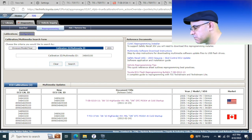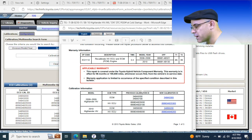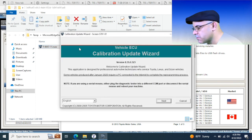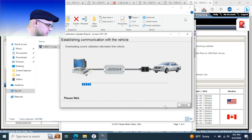This page, under configurations — which is under the calibrations tab, which is under the reprogramming tab — is where you'll put in the VIN and look it up. This TSB referred specifically to a calibration file for a 'runs rough when cold' condition — first thing in the morning, it would start up and sputter and just not run right. They have a calibration update that is supposed to remedy that. I downloaded the file — it's a .cuw. This calibration wizard was installed with TechStream and comes with the package when it unzips.